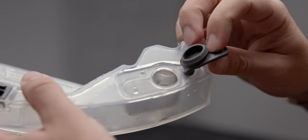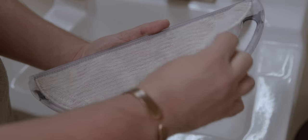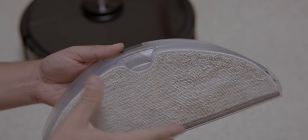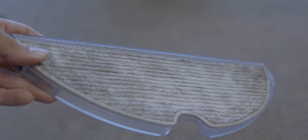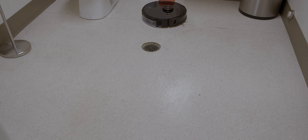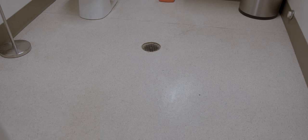Mopping is something I didn't expect to ever use — I certainly didn't on my S5 — but I'm pretty impressed. Roborock recommends only water in the tank, which we could argue about all day, but I digress. The S6 Max-V uses a massive water tank that makes up a lot of the vacuum's total mass, drawing water through a pump and spreading it evenly in front of the mopping pad. The mopping pad gets gross, which means it's working. Unlike prior models where mopping was an afterthought, the large tank and in-app settings make it feel essential — with adjustable liquid levels per room. If you have a mix of carpet and hard flooring, the vacuum will hit the rooms that shouldn't be mopped first.